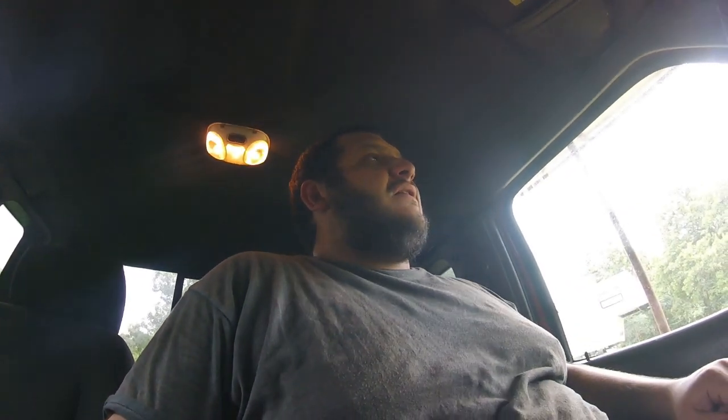So that's going to be the end of the video today. I'm back in the truck because of the wind noise. But let me know what you all think. Did you know that a thermostat could cause coolant to be shoved back through an overflow tank? I honestly thought it was another head gasket. I'm thankful that it wasn't, but now that I know, and if you know anybody that's having issues with coolant being shoved back into the overflow tank, tell them to look at their thermostat. Even if it's brand new, tell them to look at the thermostat, because that might be the issue.